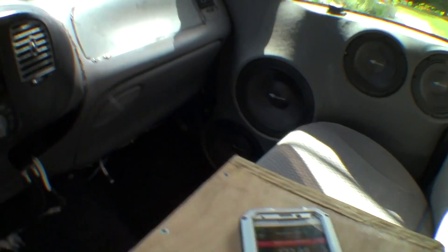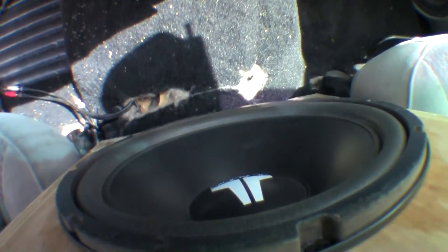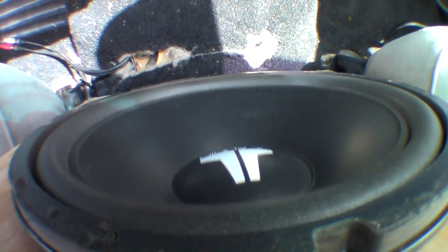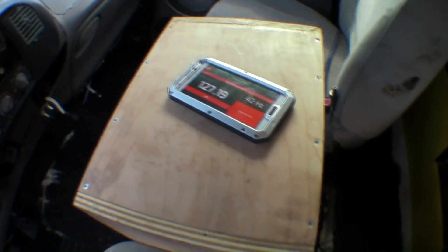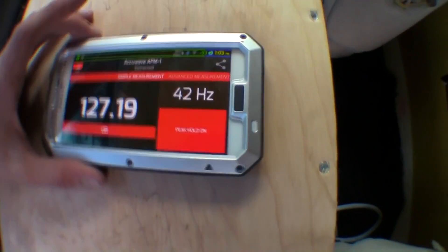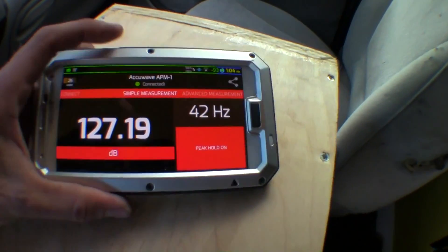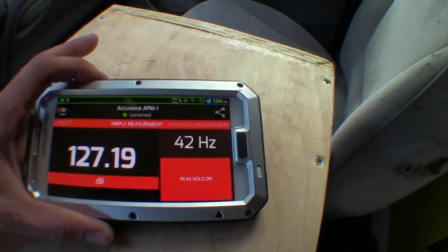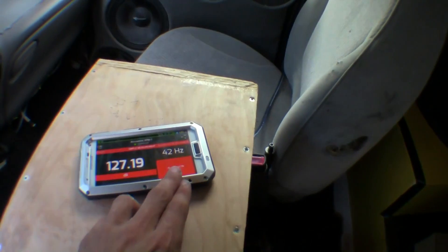And just for good measure, I'm going to do it one more time at even higher volume. So once it gets above like the 20s and stuff, I'll give it all the extra volume because I know this low bass isn't going to be peaking. Looks like we got pretty much the number here. It's looking like 41 and 42 hertz is what this cabin really likes. So if I can try to bring my tuning anywhere around to this mark, that's definitely why I gain when I take my ports out — because it almost matches this perfectly.